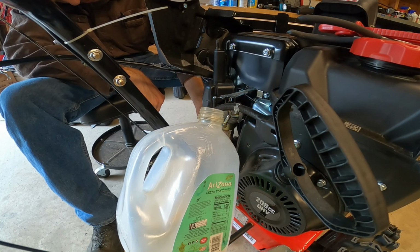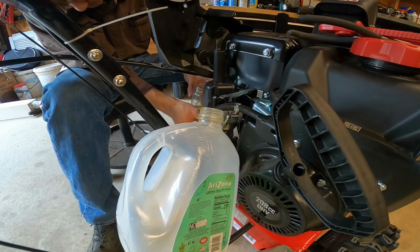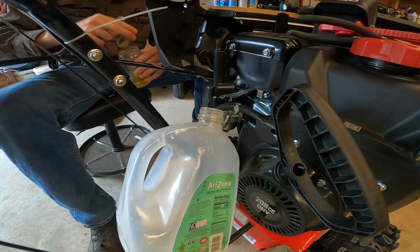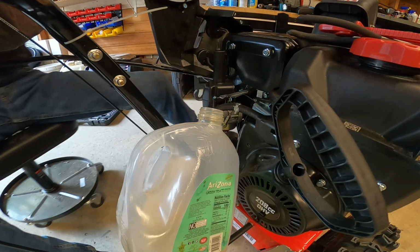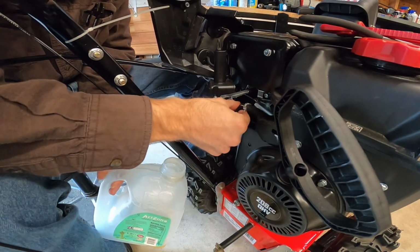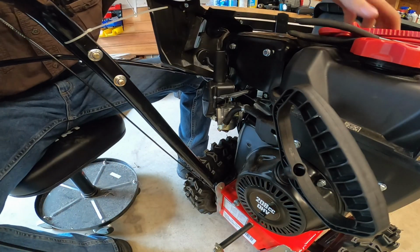And with snowblowers, they're very similar to generators. You don't use them a lot, so fuel just sits in them and gets bad. So really, if you have fuel in it, the best thing to do is to run it every couple weeks, around about once a month. This way it keeps the engine running, and so on and so forth. The problem is, and the reason I don't trust customers, is because they probably won't do that. You know? So that's why I give snowblowers back with an empty tank. Unless there's a, you know, a blizzard right around the corner.